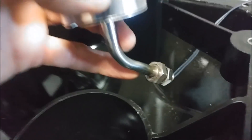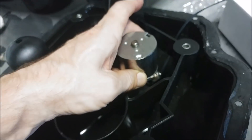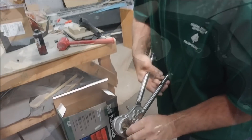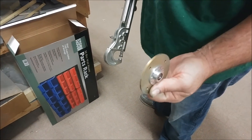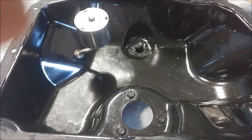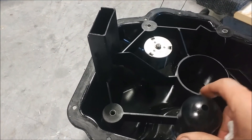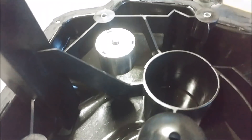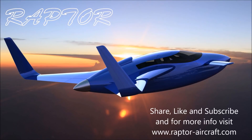Here's the oil sensor and roughly where I'm going to put it in the sump. I had to bend it at 45 degrees and getting it at the right level is a bit tricky — just eyeballed it, drilled a hole where I thought it would be, and did a little massage. Meanwhile Jeff's putting together some of the pulleys for the ailerons; he's put Alodine on those to stop any corrosion. Back on the oil sensor — that's basically how it mounts, and I had to bend it back and forth a couple of times to get it exactly level. So now we have an oil indication, we have our windage tray, and soon we'll have a little bung in there for the governor return line. Everything's moving along getting the engine all sorted out. That's our update for this week — thanks for watching.